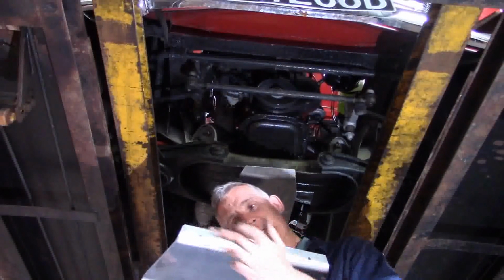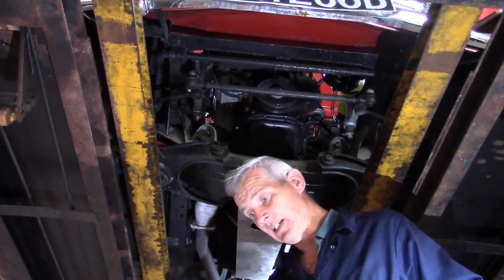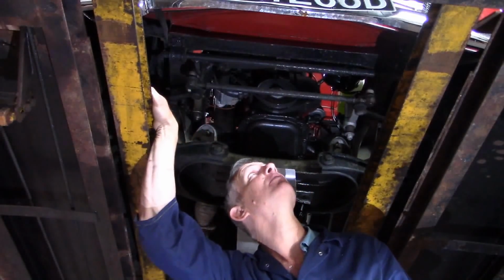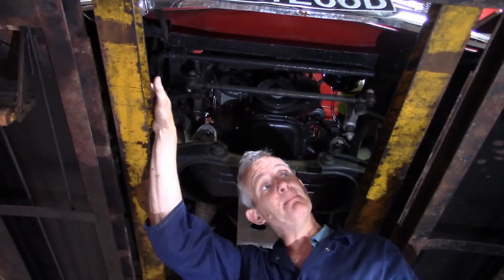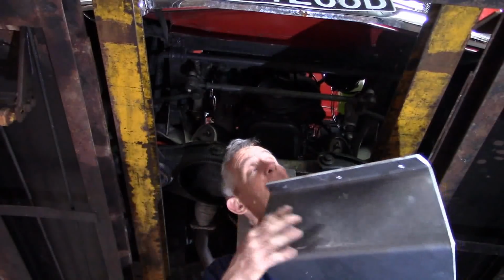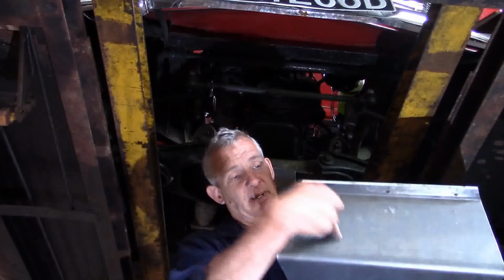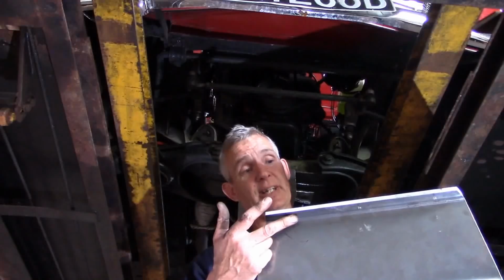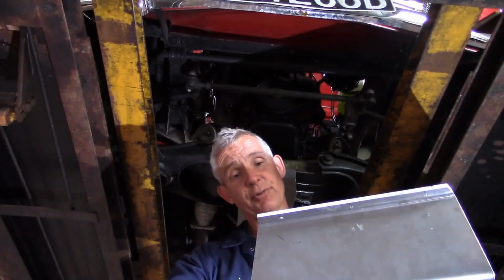There's my 3 M8 holes to secure the front of the steering guard. We'll now turn our attention to fixing the riv nuts into the bottom of the radiator cross member. Now, those of you who know riv nuts will say, oh, isn't that a bit dodgy using riv nuts in such a high pressure area? Well, of course, if you hit an impact, the force will be thrusting the steering guard upwards. So in fact, all your riv nuts are doing is just trying to gently locate this. If you do hit something very much head on, then it's in shear mode. And whether they're riv nuts or anything else, it's still just going to try and shear the bolts, nothing else. There is no real force trying to pull the riv nuts down and through.